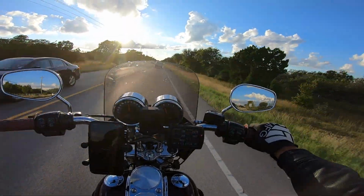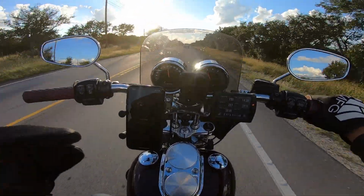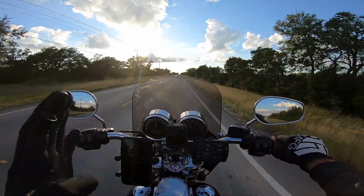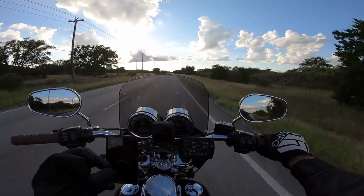We didn't restore the settings just to see if that did it, because that seemed to do the trick. It was also the USB cable, the Sena cable that came with it, that had this weird little dongle-looking thing on it. It wouldn't recognize the device on the computer, so we ended up getting a GoPro USB-C connector, plugged it into the Sena, and then all of a sudden it recognized it on the computer.